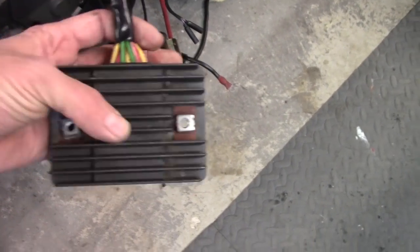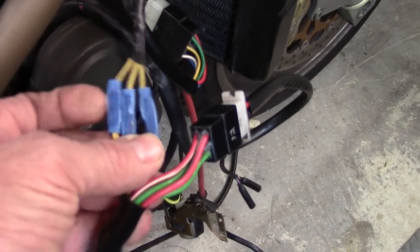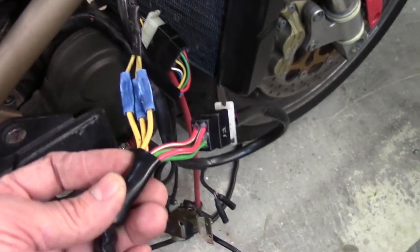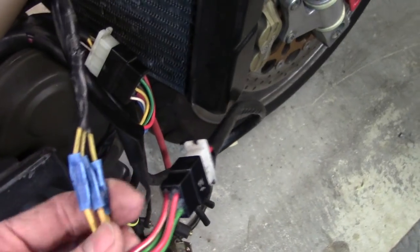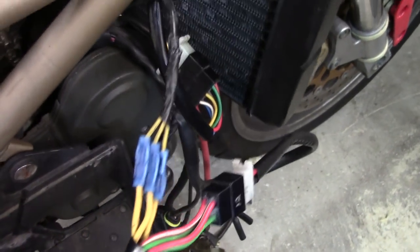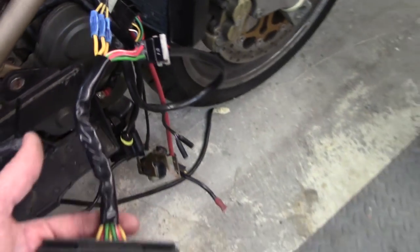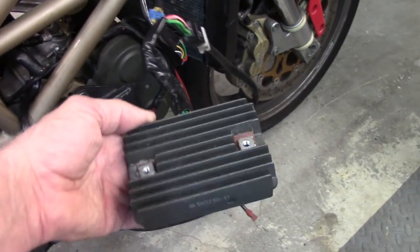The regulator's pulled out of that space and reconnected. This had been spliced up with another connector — that's not good. You want these three wires that go to the rectifier from the alternator to have really good connectors. Any push connector is going to be a high-resistance connection and limit current flow — it'll get really hot. So those are connected now with just some barrel crimp connectors. Depending on where I end up mounting this later, I may end up soldering all three of those wires.